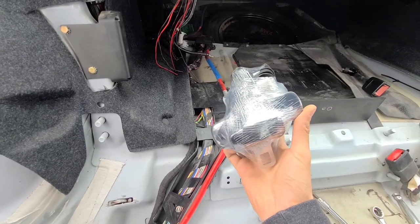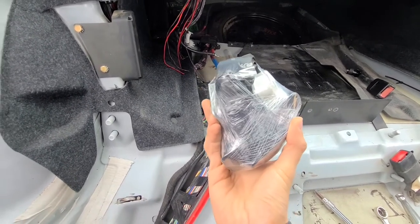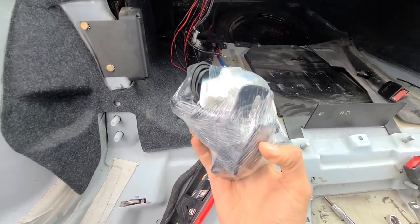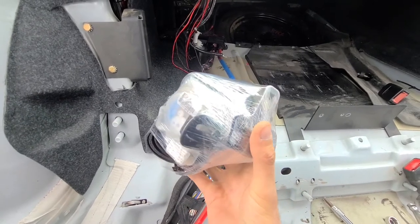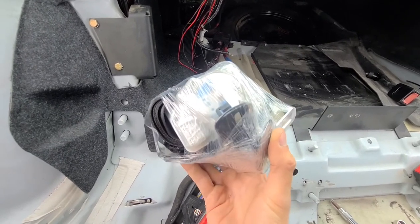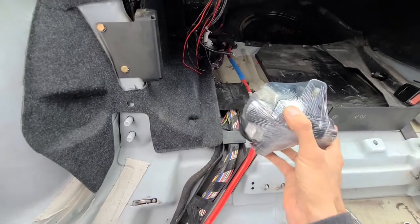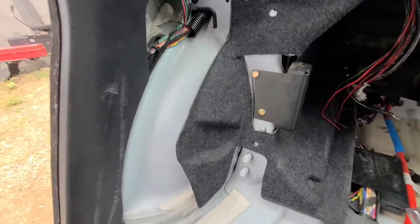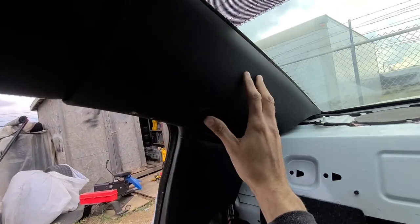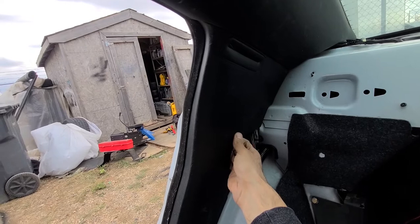I had quite a hard time finding the replacement seatbelts and seatbelt buckles for the Dodge Charger. They fit from 2011 all the way up to 2021 but none of the local salvage yards had any, so I had to have them shipped from quite far away. Luckily they sent me everything I need. Before installing, you also have to remove this trim plastic piece and this piece here as well — both of them just pop out, there are no screws holding them, just a bunch of plastic clips.